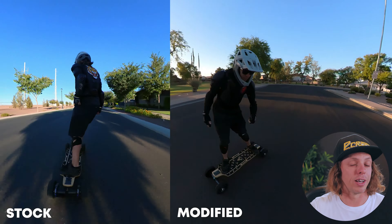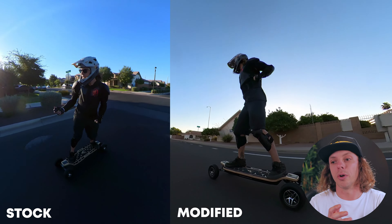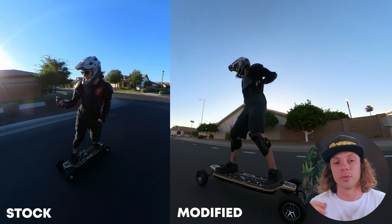It's not something I'm feeling. When I first got the board, I took it out, checked it over — made sure everything looked good and all nuts and bolts were tight. I always recommend doing that from any manufacturer. I check my bushing tightness to see how tight or loose the bushings are. Got that stuff dialed in, jumped on the board and started riding. Right when I hit about 26 or 27 miles an hour, I was getting a shimmy. I talked to some other friends who have the board and they said they were getting that too — they thought the wheels might be unbalanced. So I threw some wheel weights in there and balanced the tires, and that shimmy went away completely. These are tubeless tires, which I'll get to, and that took care of it.